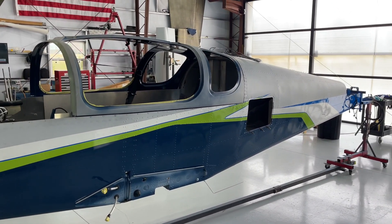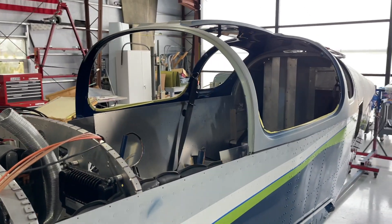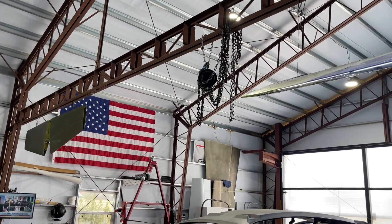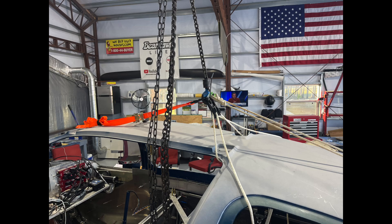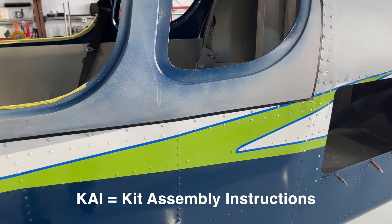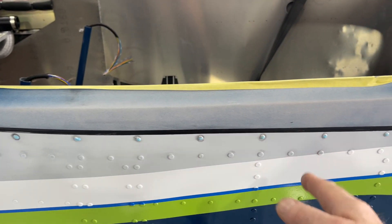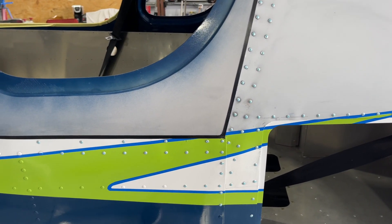I was able to install the canopy as well as the top skins — both are now permanently in place. This is the newer version so there have been some improvements; it pretty much fit right in place without much sanding. I have a chain hoist up here which let me ease it on and off a few times until I got it positioned. This canopy doesn't have the retaining strips the KAI mentions — the retaining strip is actually embedded into the flange underneath, as confirmed by metal shavings coming out while drilling. I got it all sealed and I'm pretty happy with how it came out.